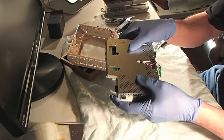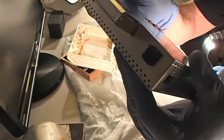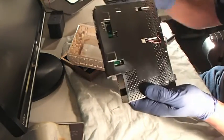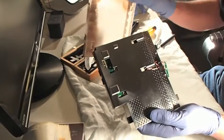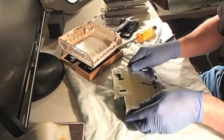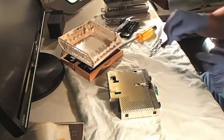What I'm finding with the top is it's crimped in places - right here, if you can see that, there are many places I have to actually un-crimp to get down to that hard disk drive. So far I was able to get it away from the case. There's a grounding wire that I had to un-pin - it was just a two-pin affair to get it out. Now I'm in the process of un-crimping metal to get that PCB, or controller card, off so I can get down to the hard disk drive.